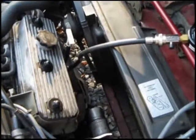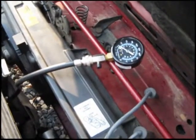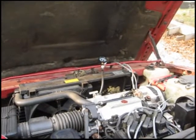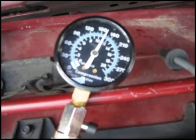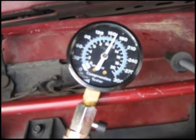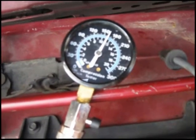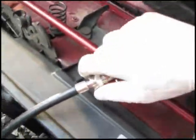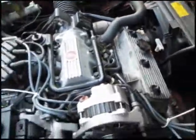I got my compression tester in the second spark plug hole and I'm going to turn it over for five or so seconds. Let's see what that one's reading — that's about what the other one said, about 170. Actually it's a little bit under 170, between 160 and 165. I'll release this pressure, disconnect, unscrew that, put it in the next one, and read that cylinder.